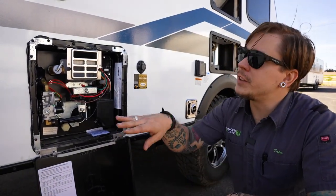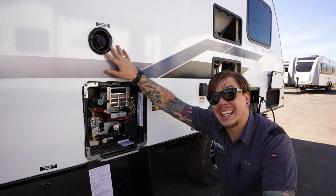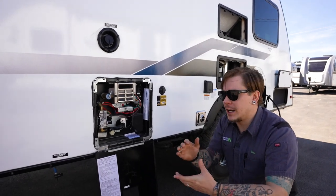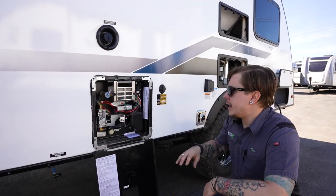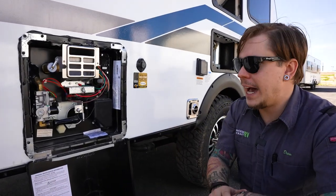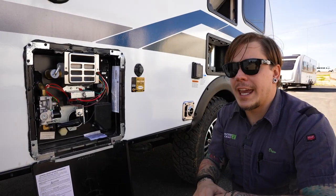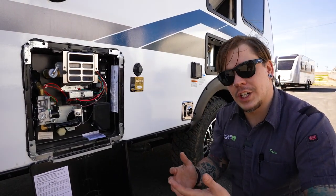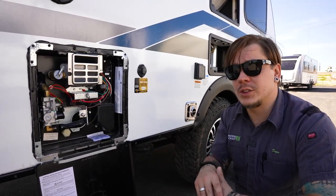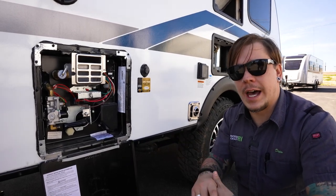What that means for you is if you're utilizing the potable water fill or the potable water tank here, you're going to flip on that 12 volt water pump to pressurize that system like we talked about. And if you are using the city water connection, it's as easy as turning the water on at the valve. So with the system pressurizing overall, you're again going to go to the hot side of that fixture. You're going to turn that on. Now you're going to see something slightly different this time. What you're going to see is definitely a lot more water, but also a lot of air as well.